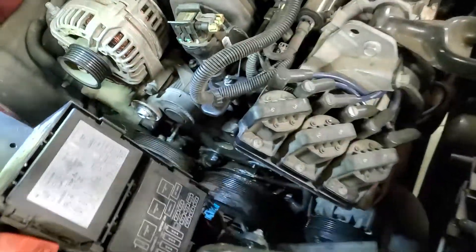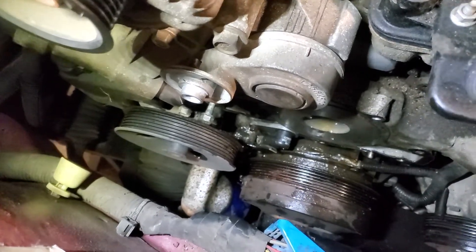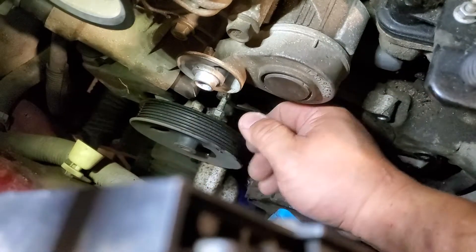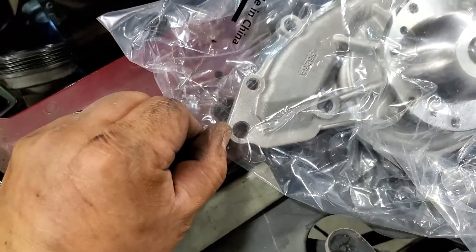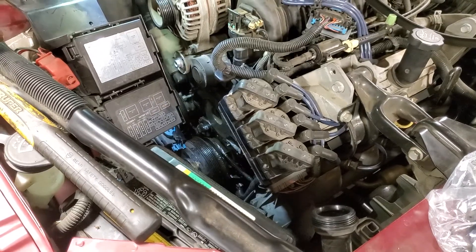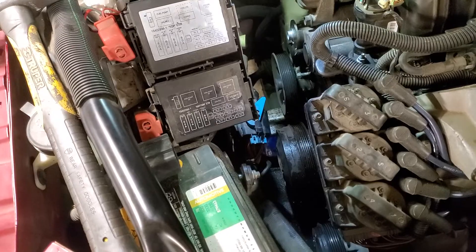Just a little hack that I do, because pulling that power steering pump or just pulling the pulley off is kind of hard to get to. So you leave that last bolt loose, about two or three turns, take the water pump and flex it out — the casting will snap right there. Then when you put the new one in, take a hacksaw and cut a groove, just wide enough so you can set it over the bolt. Saves probably half an hour or 45 minutes of time, and I've seen no adverse performance effects from that. That's all I got, thanks.